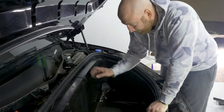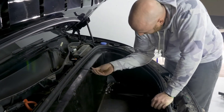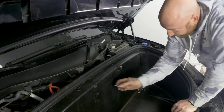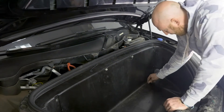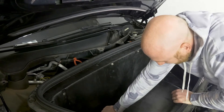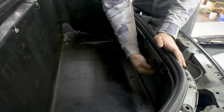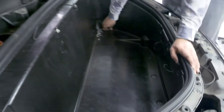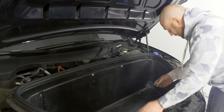When you bring the tub in, just try to eyeball that most of these are straight. You can start them by hand. These back bolts go into the filter housing and so they can move a little bit. Put a few in loosely, and then on the front, make sure you pull these wires through the tub. Now we can grab our cordless drill and secure all of these.